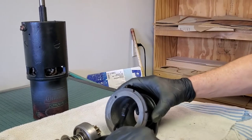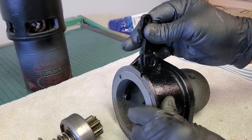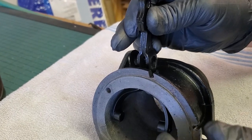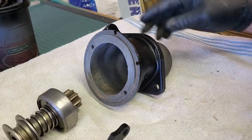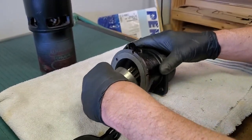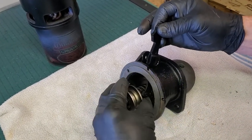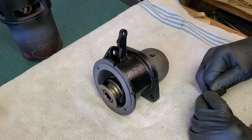This particular lever goes in here thusly on this starter — it goes to the side, the way I'm showing you. But we also have to have the Bendix drive in there at the same time, so this gets a little fussy. We have to put three parts together roughly at the same time. You notice how I rotate that in — we'll bring our assemblies together, tip everything together, and that's all the further you're going to put it for the moment, because you've got the three parts in the proper relationship.